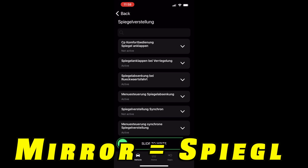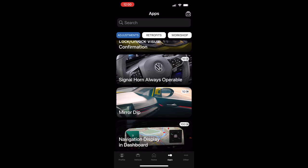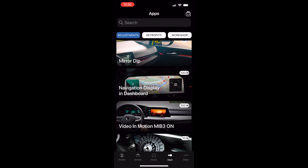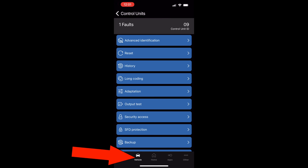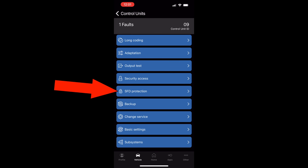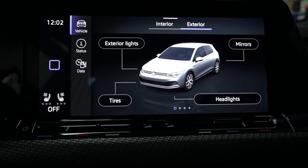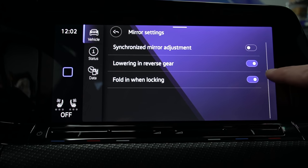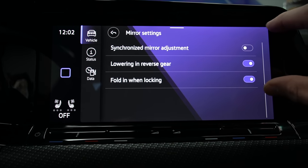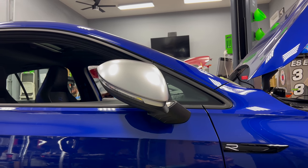Hopefully seeing it in text will make it a little easier. Now depending on when you're watching this, if you go to the apps tab, OBD11 might have it already added in where you basically hit one button and it makes all those changes for you. You do need credits to do that, but it makes it pretty easy. We also want to go back in and lock that module back up — go back into module 09, central electrics, under vehicle, and go to SFD protection and then lock it. Your module is now locked back up. On your touchscreen, if you go to Vehicle — Mirrors in the exterior — you have lowering in reverse and fold when locking. Make sure that's on, otherwise they won't fold when locking. One of the things we just turned on was actually activating these choices in this menu.